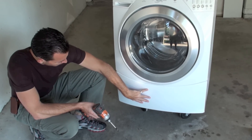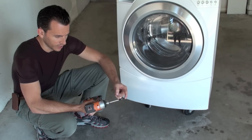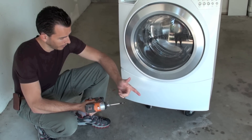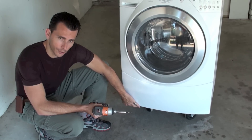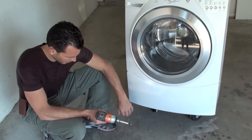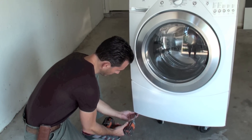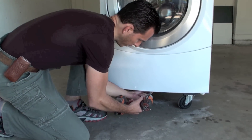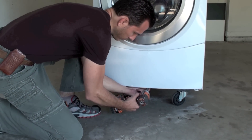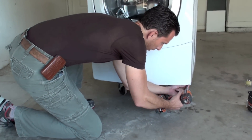On the Whirlpool, the same T20 bit or a 7mm. GE and some other machines use a quarter-inch nut driver or a Phillips screw. There are three screws right here at the bottom — one in the middle and one right here at the side.